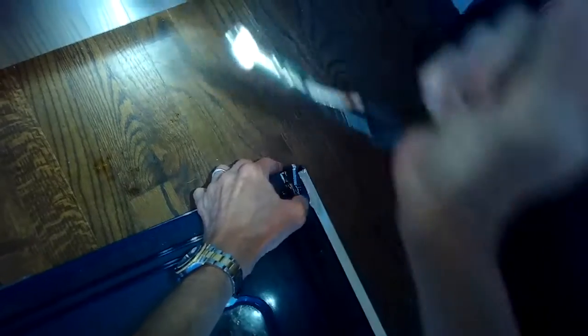So just to review it, if we look at these, one is correct, this one's good, but this one kind of sprung the wrong way. So we got to use, again, some kind of big pliers or vice grip to grab it, and we're going to bend it out about 45 degrees and then bring this piece in. You got to make sure it really sits. See, it just failed, it gave way. Keep playing with it until it stays at that 45-degree angle. There we go.